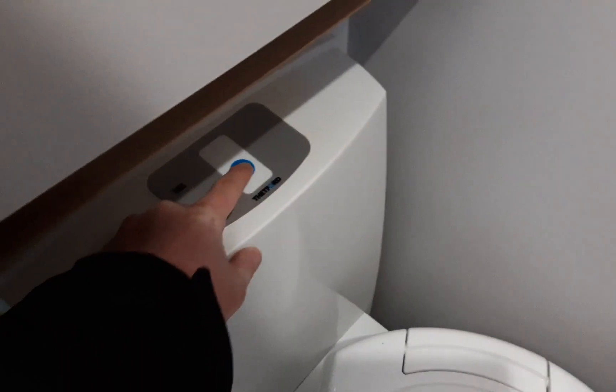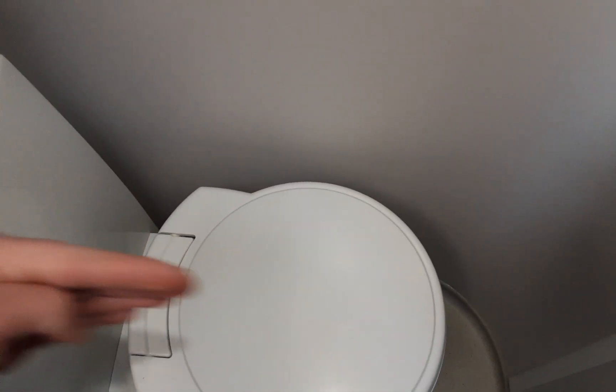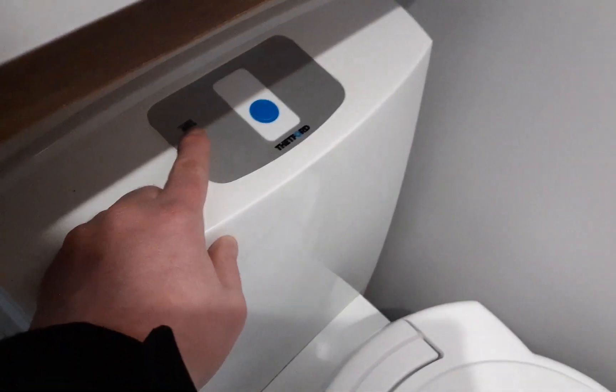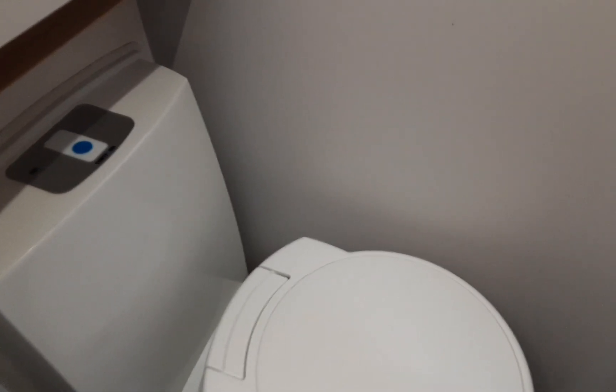In the bathroom you've got your shower, taps and the toilet system with an electric flush. The toilet seat turns for your convenience; however, when removing the toilet waste cassette, the seat needs to be pointing straight across the caravan as it is now. There is a full indicator light that illuminates red when the cassette is completely full. Below the front of the toilet you have a grey waste handle which you push to the furthest point away from the shower to allow toilet waste into the cassette. When not using the toilet, return this handle to the central position to prevent smells and to allow cassette removal.